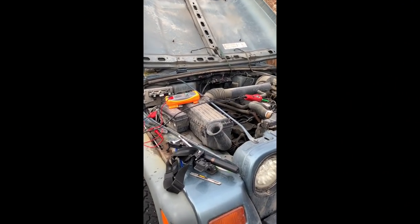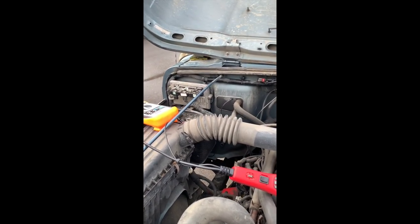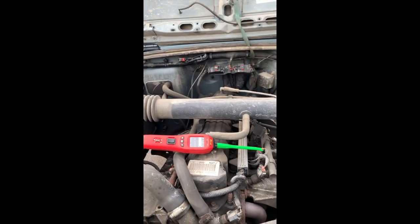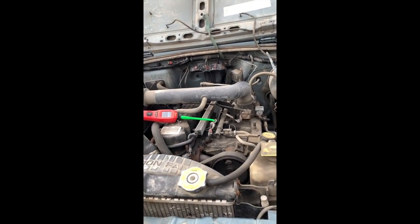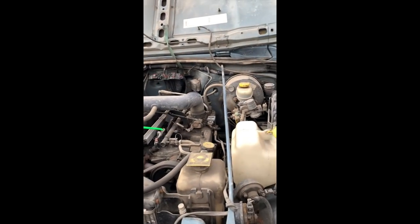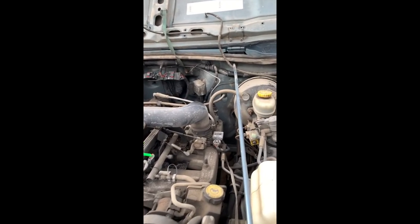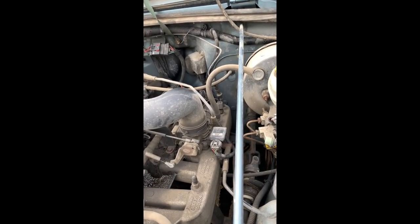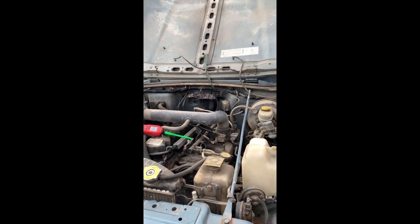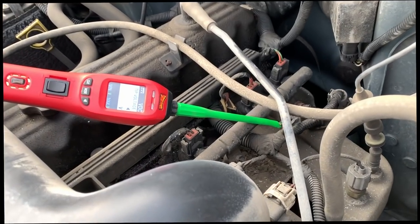All right, good day. Testing Trevor's Jeep. Computer checks out fine for 5 volt and 12 volt going in. The resistance on the ground is a little high. No pulse going to the injectors, nothing in the coil. The codes we had were able to clear, not come back. So maybe that crank position sensor is the faulty issue here. Trevor's gonna have to maybe fish it out.